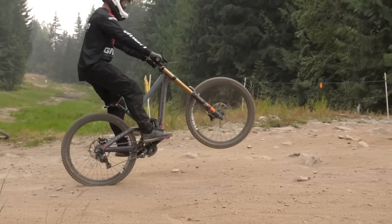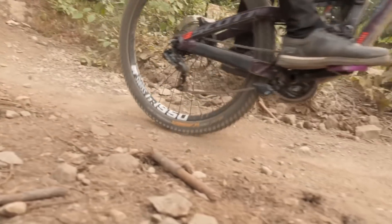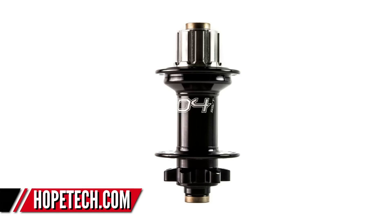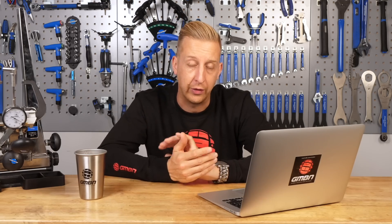However, it does pose a few issues if you did this system on a normal bike. Essentially, the cassette-style system is a lot more reliable, and it's designed to cope with the load that mountain bikes and all the gearing put through them. Traditional freewheels, whilst they work quite well, are susceptible to issues. If you wanted to use a cassette-style system for trials, you can do this now — there are cassette systems like the Hope Trials one, you can see on screen now. That has a dedicated steel body, it's designed to be set up single speed, and designed to cope with the stress that you can put through that hub.